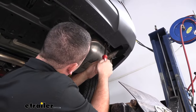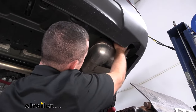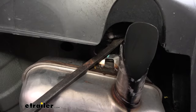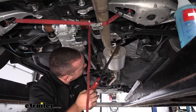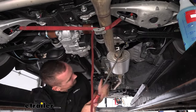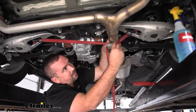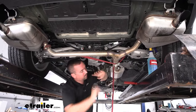You can remove the bottom or the top isolator — it really doesn't matter, just as long as we get our isolator taken off. If it's close to the edge, sometimes you can move the muffler a little bit just to get that extra clearance to slip them off. On this one you can use the hanger arm to pry on it — this one is a little bit wider and a longer section, so again if you need to, you can pop off the top one. With all of them removed, you can see our exhaust is resting on the support. The cam buckle strap is nice because I can just slowly lower this down and it's still going to support it, giving us the clearance to get to our holes in the frame.